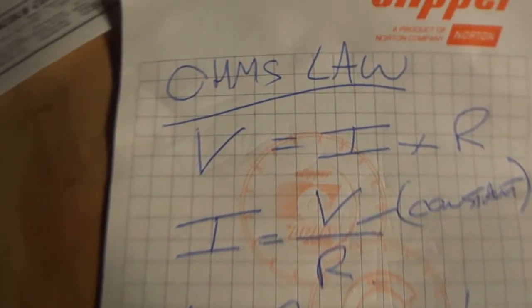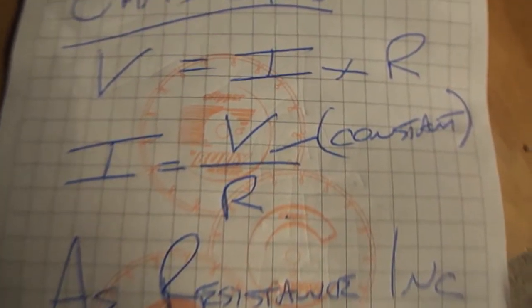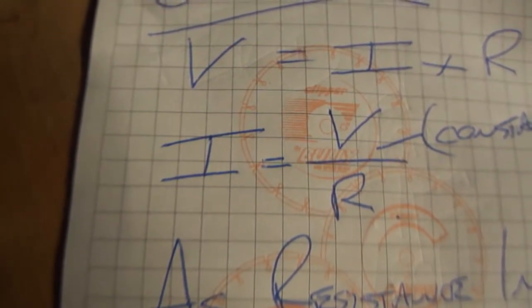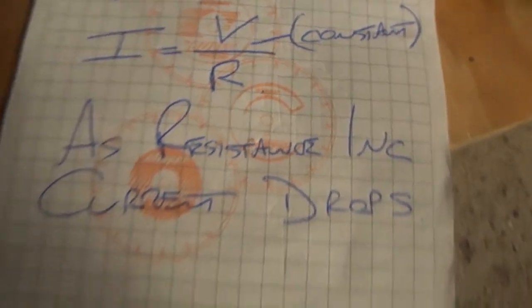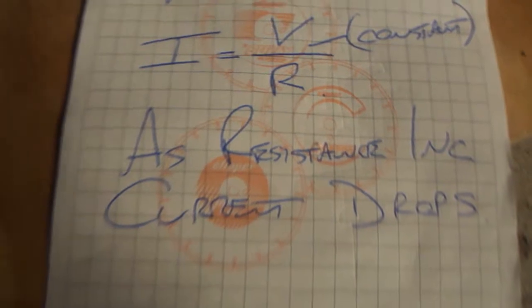On a vehicle, this little equation shows that as resistance increases, the current drops — which is pretty apparent. Resistors in series can be added together. So on a system where we have 12 volts and two resistors — two ohms and two ohms — you add those two in series and it gives us four ohms. So if there's 12 volts on this circuit and two two-ohm resistors in series, the current is going to be 12 divided by two plus two, which is 12 divided by four. This gives us three amps.